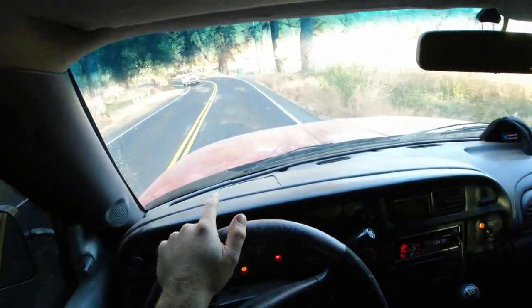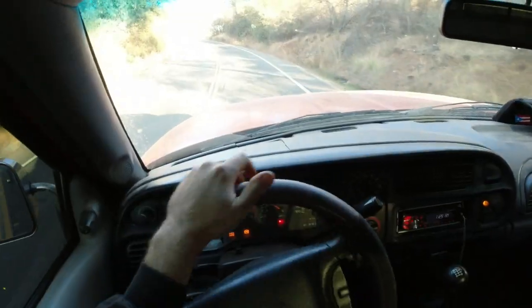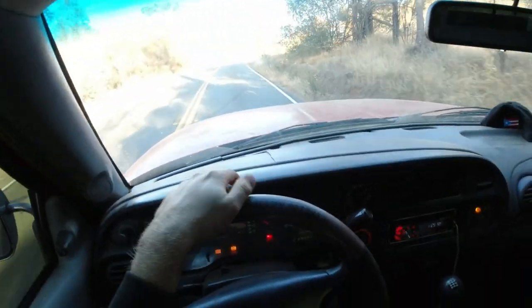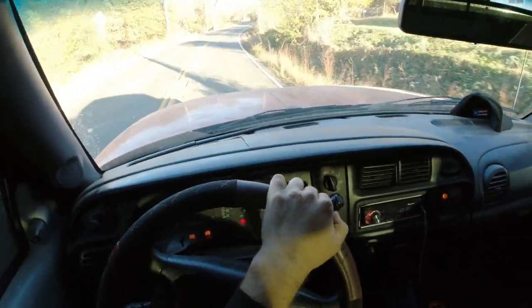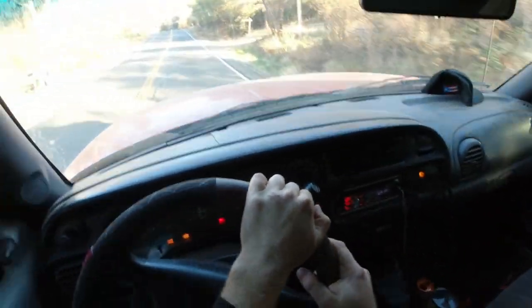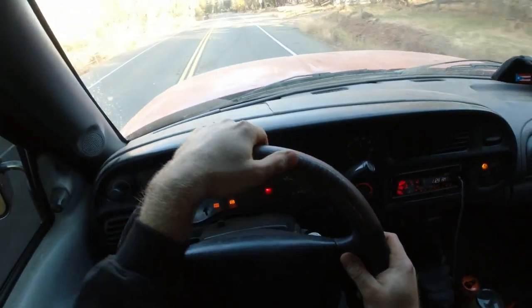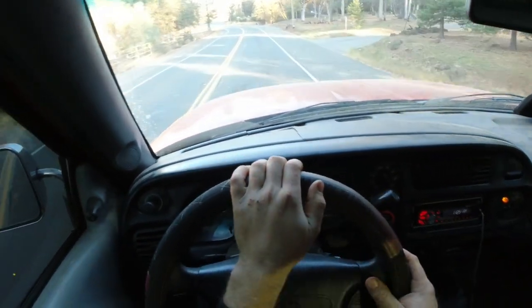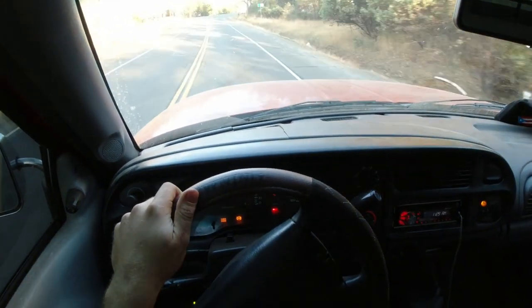What's this? Oh, a brand new 2019. How's it going, fella? That's like a kid driving that. I had to get that truck. I don't have gauges on this rig yet, and the truck is mildly modified. I don't want to risk cooking a piston or something with EGT, so I just had to drop her down to third. It seemed like fourth was bogging it down. Pulled that hill at 25. It's like driving a Toyota, empty. And my thermostat seemed like it was sticking open, because the truck wasn't wanting to warm up. She's warmed up now. She's right at operating temp.